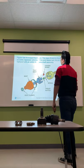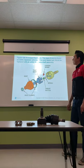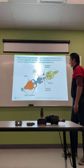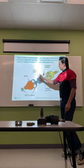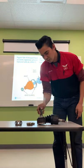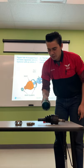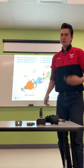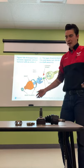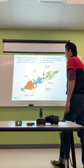A tripod fixed joint is found on some Japanese vehicles. If the joint wears out, it is replaced with an entire drive axle shaft assembly. While you can rebuild these, the parts are harder to find and you still have to charge the customer more labor for the rebuild — so most of the time it makes more sense to just replace the entire axle.